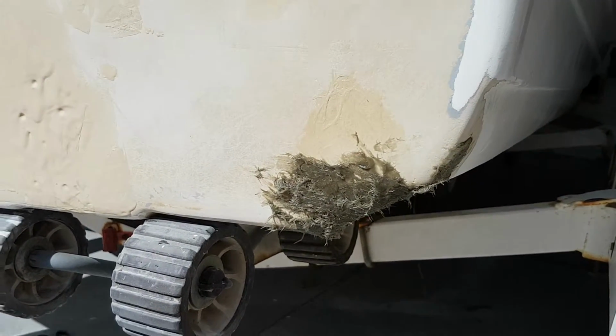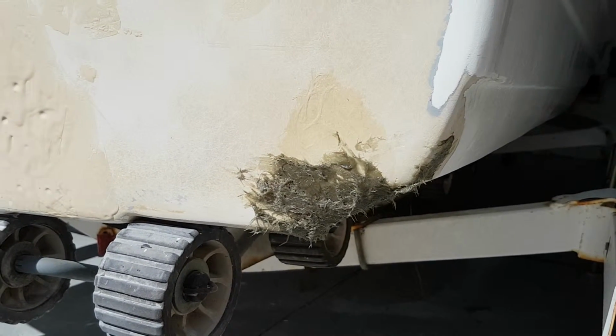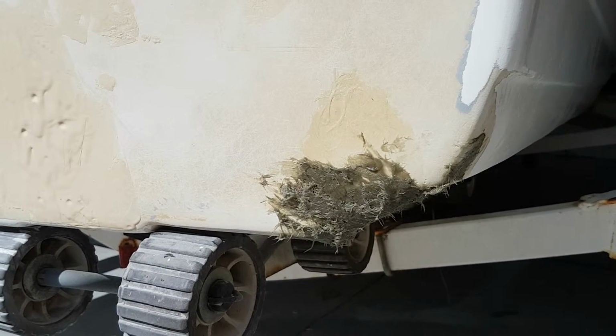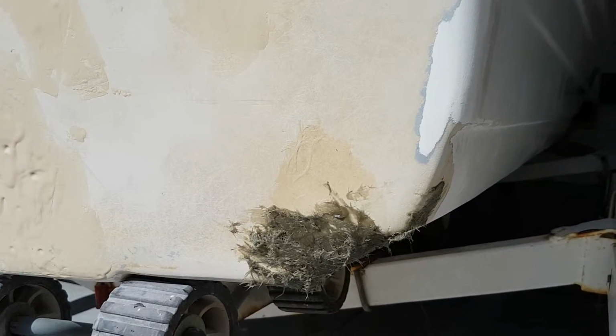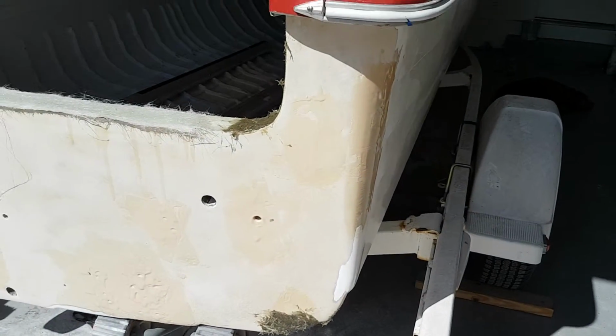So like I said, I talked to Sam, great guy, and he turned me on to the structural compound. Now, this is reinforced with long strand fiber. It's a very fast hardening epoxy resin, and you use a cream hardener with it. And it works amazing. The stuff goes on. You only have a couple of minutes to work with it, but you goop it on,